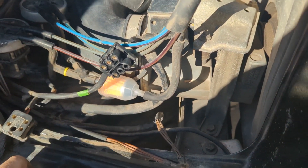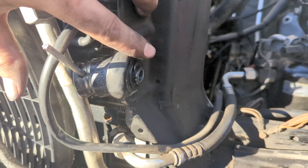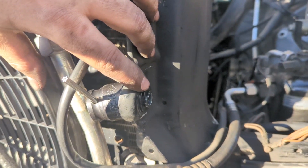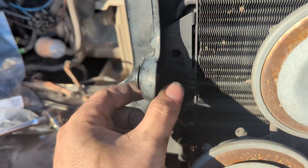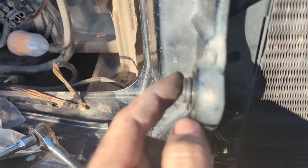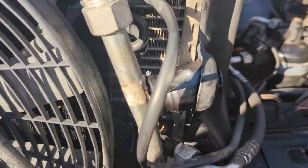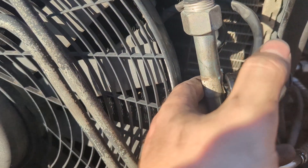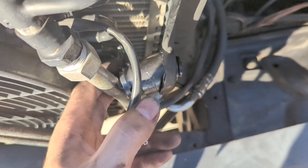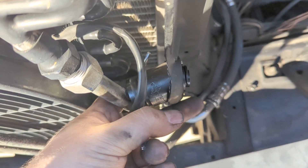Just to wrap up some of this wiring, put the headlamps in, put the turn signals on, and give it a go. This piece is included in the headlight refresh kit. On one side it's pretty easy — I found you can fit the 24mm socket in here and just turn it until you get the position that you want. On the other side it's a little tighter, so I just put the 24mm socket in and there's a hole you can fit something through, so I put a torx through it and used that to leverage and turn it. That worked out pretty good.